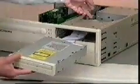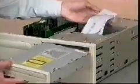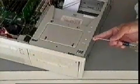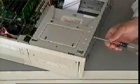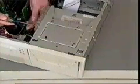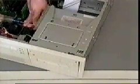You are now ready to insert the CD-ROM drive into the drive bay. First, pull the cables through, and then slide the drive in from the front of the computer. Push it in until it is flush with the computer face. Now, using the screws that came with your multimedia kit, secure the drive to the computer chassis. You will find holes on the side of the computer chassis that will align with the holes in the CD-ROM drive. Gently screw the chassis to the drive. Do not screw it too tightly, just enough to hold the drive firmly in place.